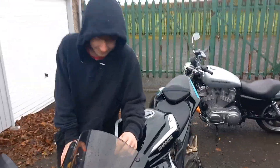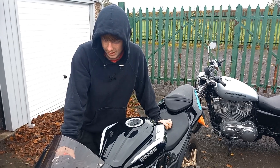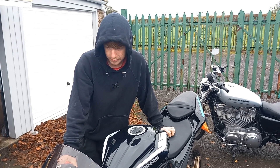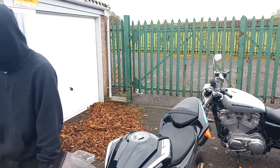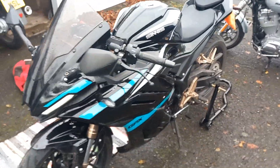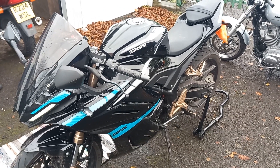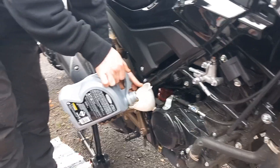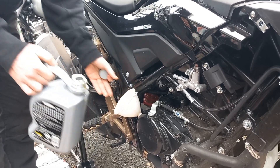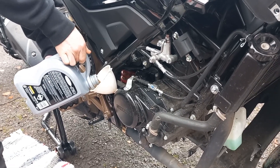So once you put the new oil in the bike with the dirty old oil filter, what we'll have to do is start it up and bring it up to temperature. Once it's up to temperature we'll just check the levels again. It seems like it's only running on one cylinder, mate! Once you've warmed the engine up, you'll find that once the oil all circulates around everywhere, it'll dip again on the dipstick — you just give it a wee top up, check it again just to be sure, and then it's a case of putting the fairings and stuff back on.